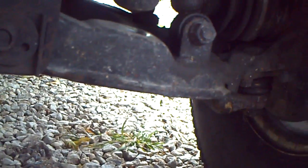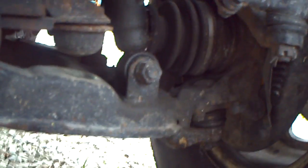Moving underneath, we're going to remove this hose clamp right here. As you see, we moved our bucket over to this side. We're going to go ahead and position this, because we have to take this hose right here off the bottom of the engine. So we're just going to take this loose, so that way we can remove it and let it drain out.